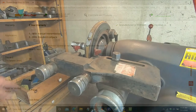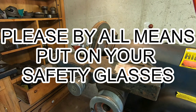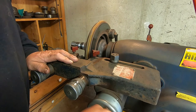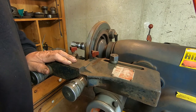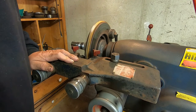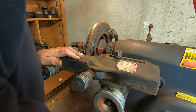I'm finally ready to start cutting. Off camera I brought both of the inserts in so they just barely contact the rotor and then zeroed out the dials. Now I'm bringing the cutters out so that I can cut off that little ridge at the end of the rotors. Now that that ridge is gone, I'm going to bring it in and make my first rough cut adjustment. You want to take off at least 4 thousandths at a time — to take less than that would cause the rotor to get hot and also you run the risk of causing vibration.